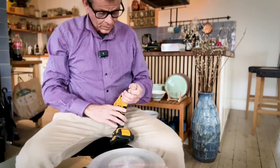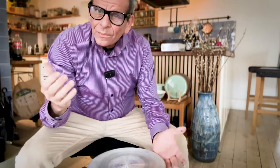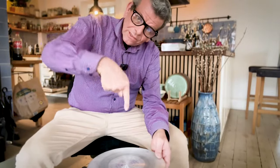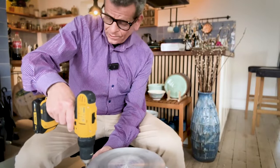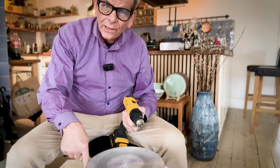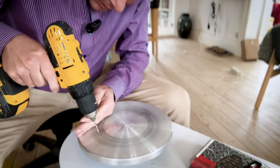So I'm going to put that in. Of course it would be easier with a mechanical drill press where it's completely vertical, but I don't have that and it's difficult to unmount this wheel head. So I'm just going to be very careful and make sure it's completely vertical. Also, because we're drilling into the wheel head and it doesn't go deeper than the head itself, I'm not risking drilling into my wheel. But in case the gap is smaller or your drill bit is longer, put a piece of wood underneath so you drill into that instead of your wheel. So let's try this out.